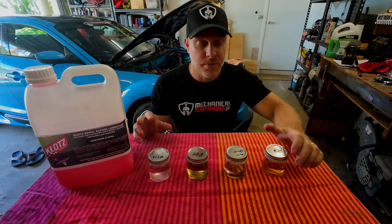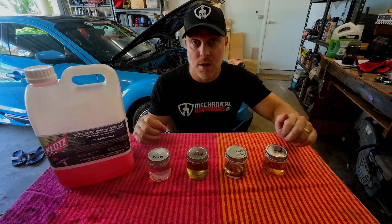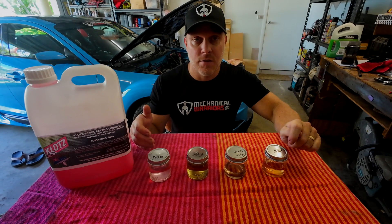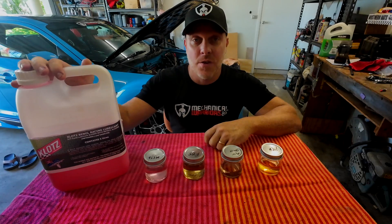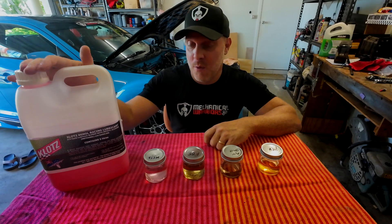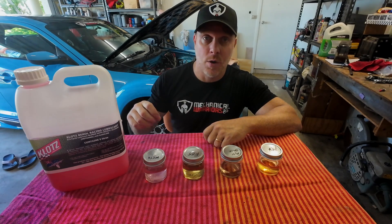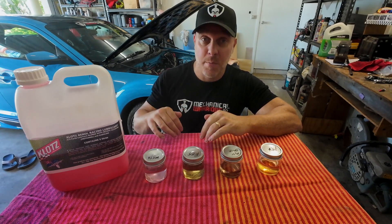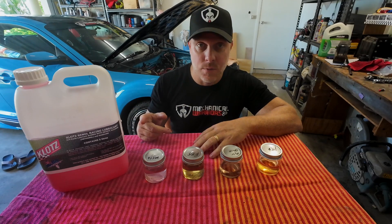However, if you mixed up a batch of fuel, put it in your tank, and then just started the car and left it idling for a while, you could potentially have a situation where you are sucking up un-lubricated fuel and cause damage to your engine. The safest practice is to pre-mix your fuel in a 20 litre drum, put it in the tank — that way you know 100% you've got a perfect mixture. I can confirm that Klotz Castor Oil does stay suspended, but make sure you mix it properly first, because when you pour the castor oil into the fuel it does sit on the bottom until it is mixed.